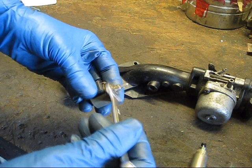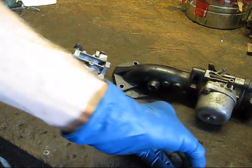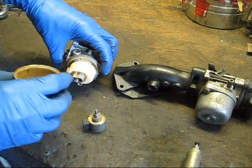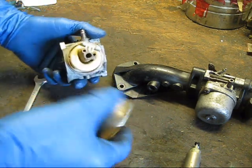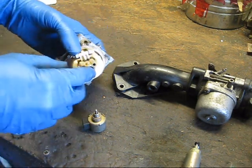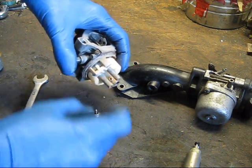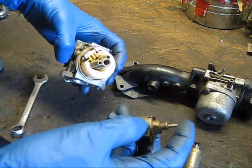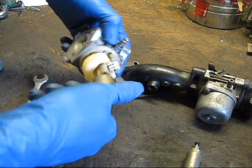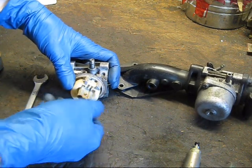For the Nikki, you can just use a standard wrench — there's plenty of space. So this is my wrench that was specifically ground down for this purpose. We're going to use the Walbro LMT as a demonstration because I don't have to undo two extra screws to get it apart. If you look inside here, you'll notice that the main jet is on the side rather than on the end — this is how Walbro does it. The solenoid has a plunger on the end, and that plunger, when it's installed, fits right in there. The way this works is by blocking the flow of fuel through the emulsion tube on the carburetor.